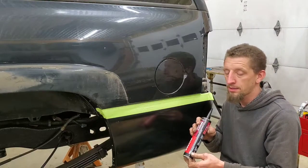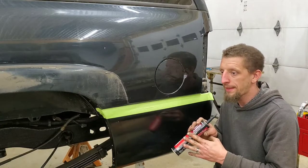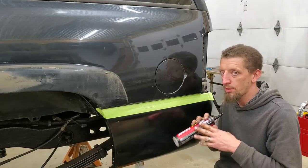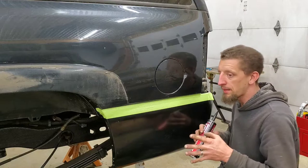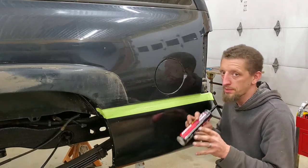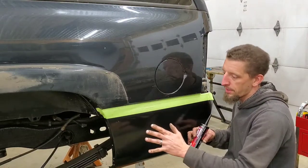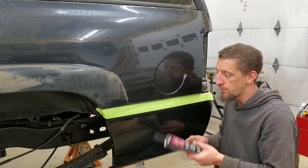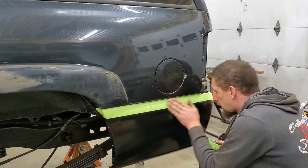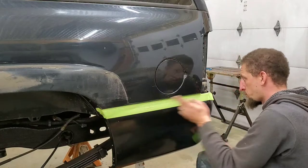The downside is how long it takes to dry. So it cures to a tack in like 24 hours, but it cures out right around 7 days. So keep that in mind for whatever project you're using. So that is the downside. Upside cost, downside time. This isn't going anywhere, so I'm not worried about the timing on this. So that is what I'm using. And right now what I'm doing is I am setting up for the injection and then the swipe.